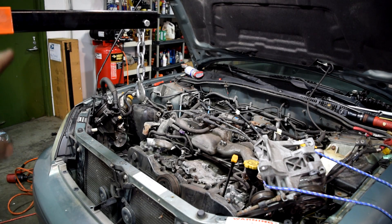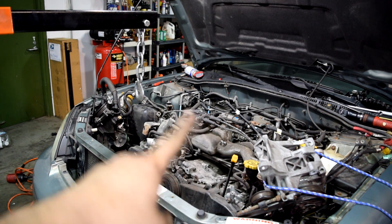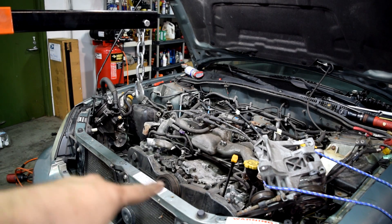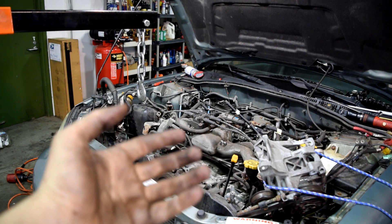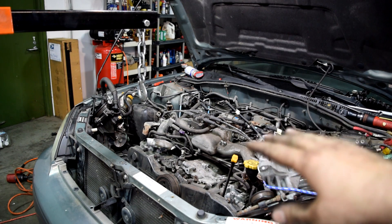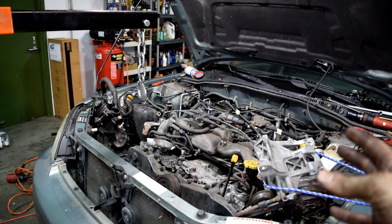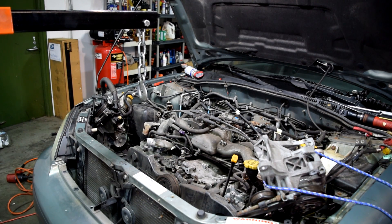Here's the plan: we're going to get some seat belts, attach them to the sides of the intake manifold — two sets, just for extra safety measures. Then we're going to raise the engine. Once the studs of the motor mounts clear the subframe underneath, we'll be able to pull the engine out and disconnect it from the transmission. Before we do that, I'm going to get a jack and put it underneath the transmission. After we raise the engine and transmission enough that the studs clear the subframe, we'll support the transmission, then pull the engine out and clear the two studs underneath the engine from the transmission side.